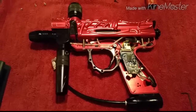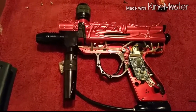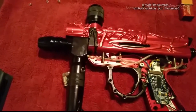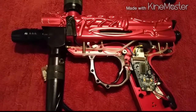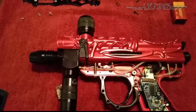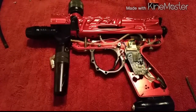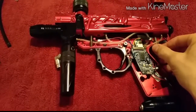Having never done this before, I'm just kind of treading in uncharted waters here. I'm going to be randomly taking things apart — may or may not need to do all of this just to get to what I need to replace. I'm thinking I'll take these two screws out here to remove this piece and get it out of the way so I can get to the air barb and unscrew it to put the thread lock on. I paused and used a 1/8" allen key to loosen those screws.